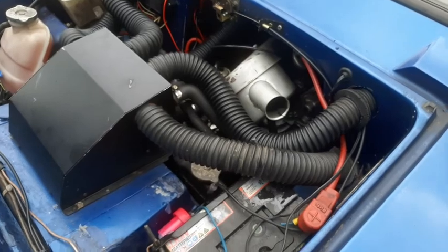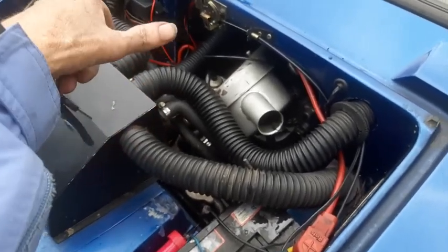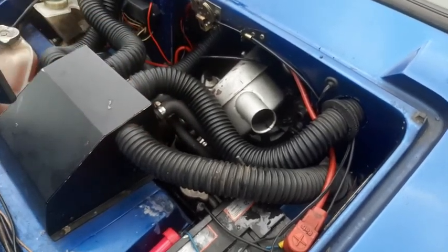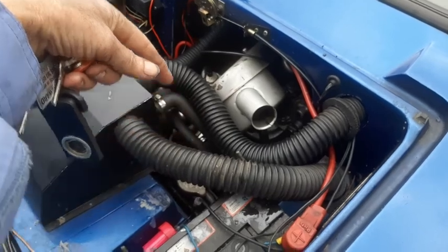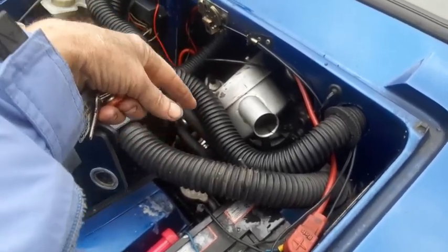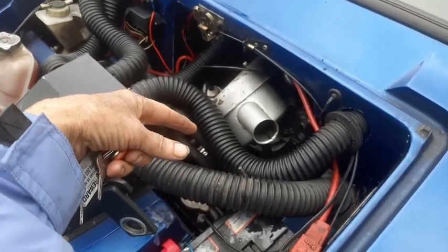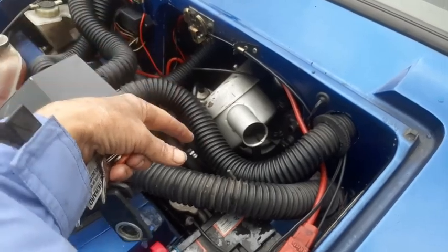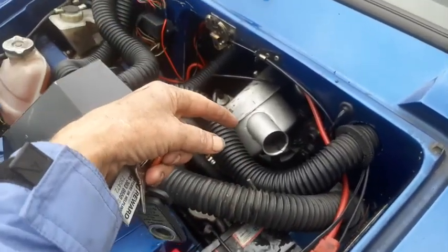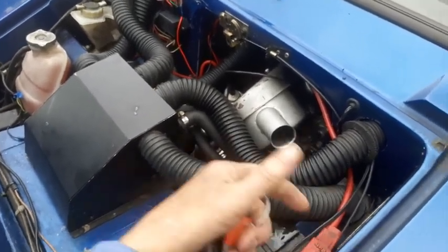And he tinkered around with it for a while, looking at the timing and looking at the points. He pulled out the distributor unit, and he said, "There's no worm gear on the end of the drive shaft that drives off the oil pump. The worm gear's been ground away to nothing." And we're talking a brand new car here. Turns out that the worm gear hadn't been hardened, and it had literally worn itself away. So, yeah, back into the shop.